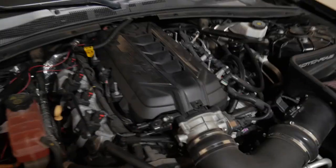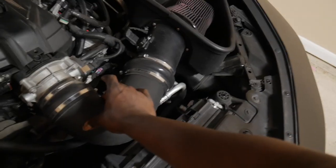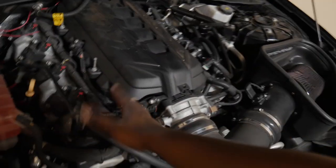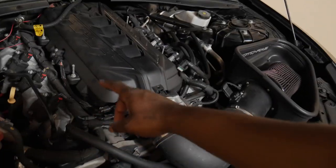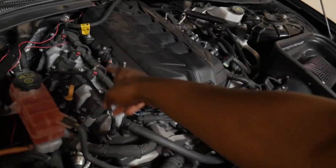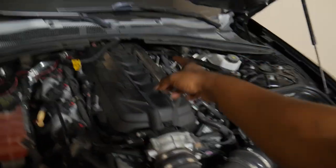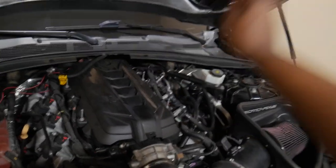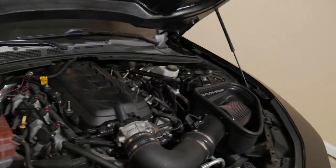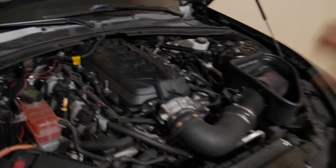Enough rambling, let's go ahead and get straight into this video. Basically it's going to be an 8mm bolt right here, 8mm bolt right here, and then the cold air intake will come off of the throttle body. Then it's a total of 10mm bolts — or it could be 8mm, one of the two — and the entire intake manifold will come off. You're also going to want to disconnect your MAF sensor, and there is an oil line that runs to the back of the intake manifold that we'll need to take off. We need to drop off these parts by 7 o'clock, so let's get to it.